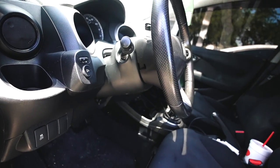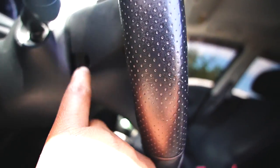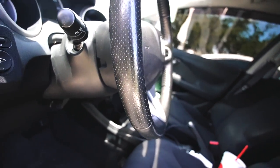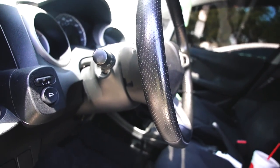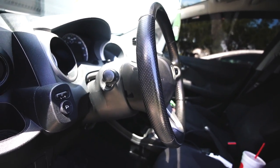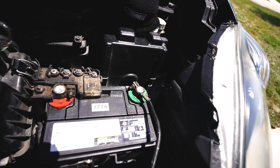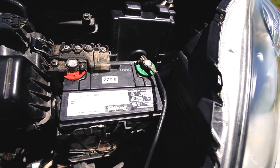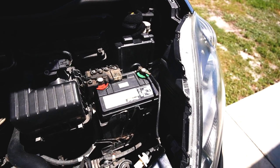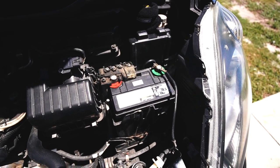If you've never removed a steering wheel, there are a couple of T25 or T27 Torx bolts — one on each side. First thing we should do is disconnect the battery, because we don't want the airbags going off. We'll take a 10mm, remove the negative terminal, and then we'll be good to go with removing bits and pieces from the interior so the airbag doesn't deploy.